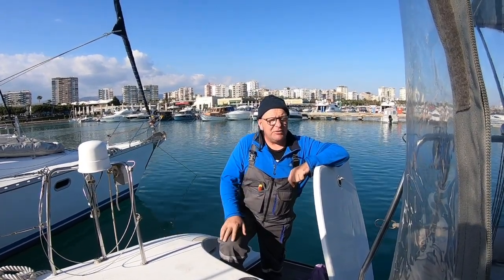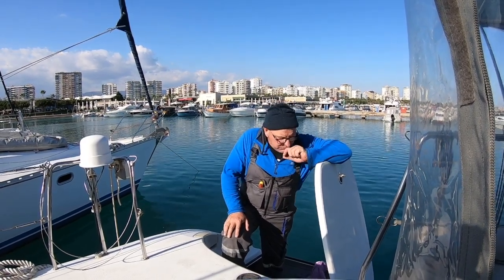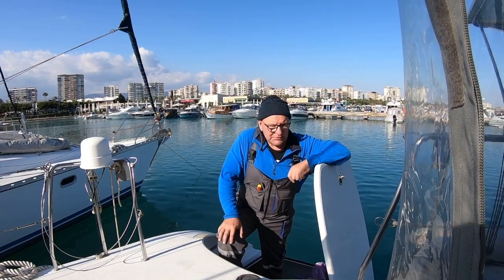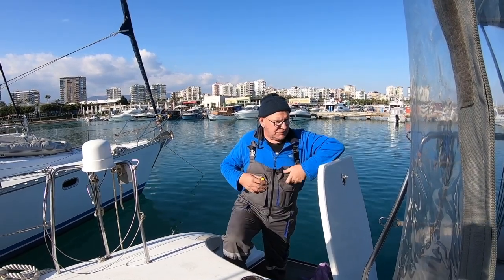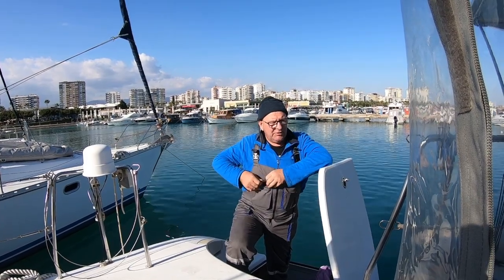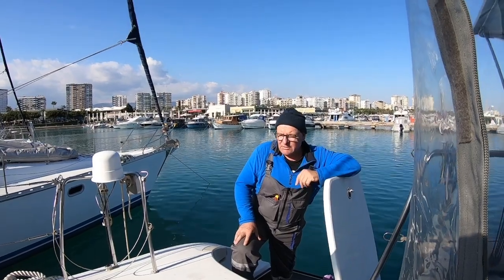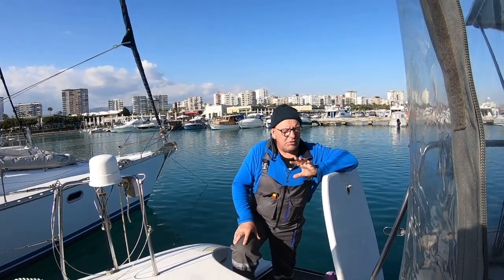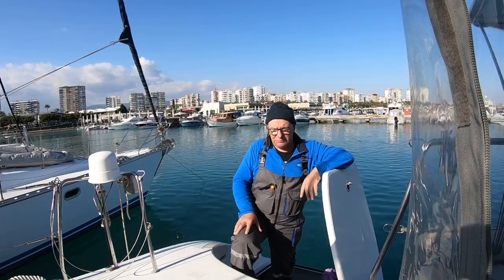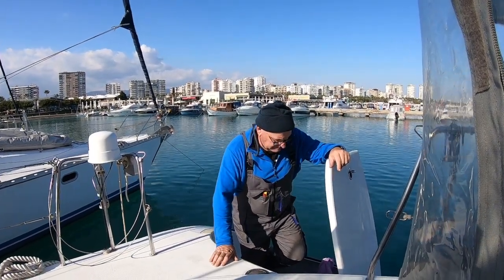I've adjusted the tick overs. Peter was saying that the tick overs didn't match properly, and one engine was running just slightly faster, so just check that the tick overs are right. I'll have to adjust it again when the new air filter's going on, but other than that, yeah, job's a good one.